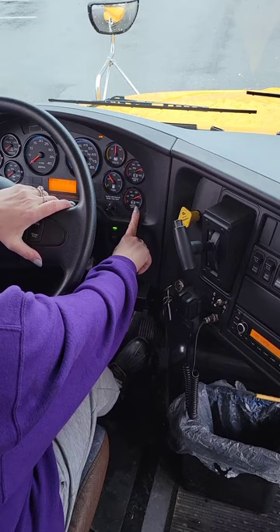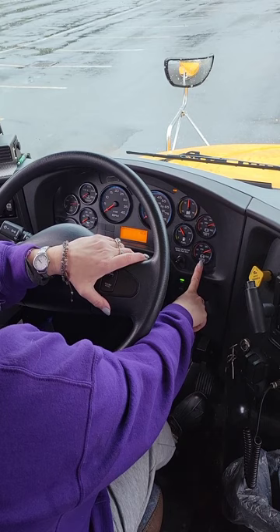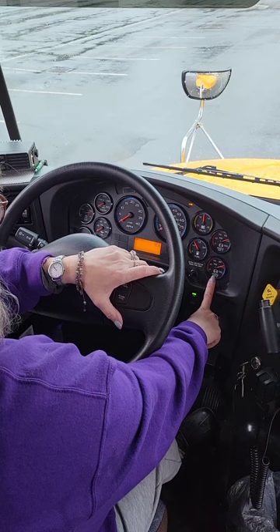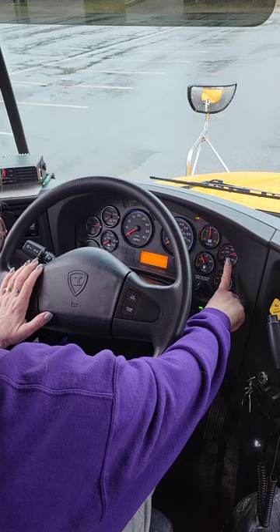Back and forth from your watch to the gauge. Make sure that examiner sees your head move, even if it's ever so slightly. They want to see you looking back and forth. They will make you wait up to one minute, but for the purpose of the video, I'm only going to go 30 seconds. Still no movement. That's my 30 seconds. Now I'm going to put pressure on the service brake. Once the gauge settles, I'll time it for one minute for no more than three PSI loss.